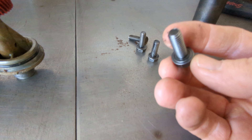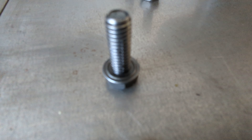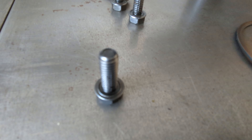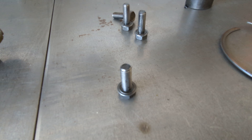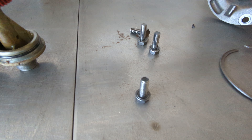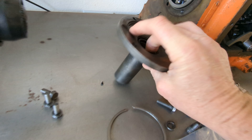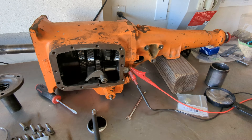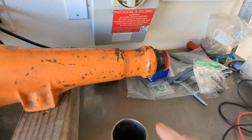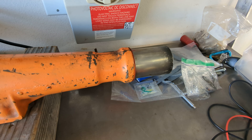We're going to put a new front seal on that. These bolts are special in that there's kind of an O-ring groove built into the sealing surface — that thing's going to seal up against there without having to use any type of gasket or anything like that. We'll get this transmission running, put a new seal in it. Had this piece of pipe laying around to drive that in and that worked good.